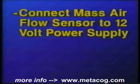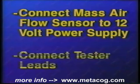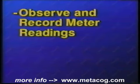Let's review how to test a mass airflow sensor that has been removed from the vehicle. Connect the mass airflow sensor tester to a 12-volt power supply. Connect the universal tester leads and the digital volt-ohm-meter leads to the sensor. Turn the meter on and set the scale to 4-cylinder tach or RPM. Observe and record the meter readings.